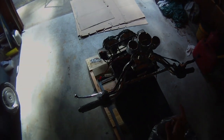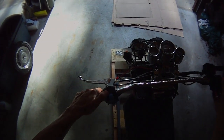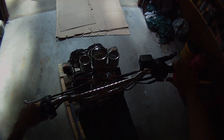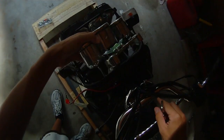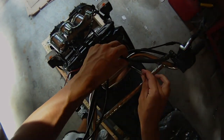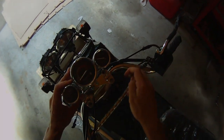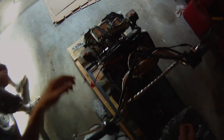Alright, step one — we want to look at the handlebars on the bike. There's your headlight, and you want that on your left-hand side. Stop/starter ignition on your right side. You get all your wires through this little hole right here, and we're going to take these bolts off. This is what we're going to do to mount the handlebars down.